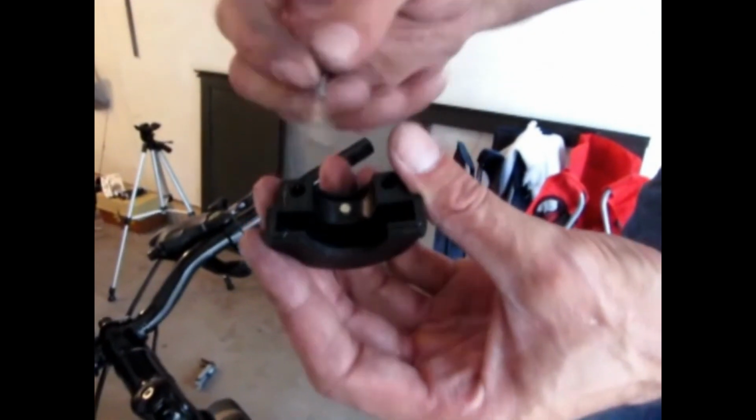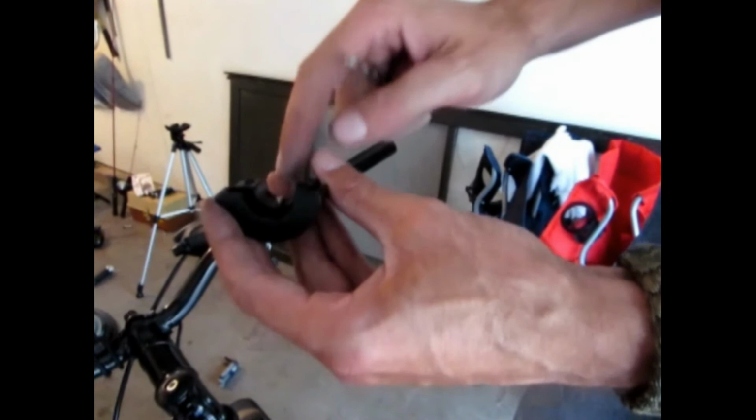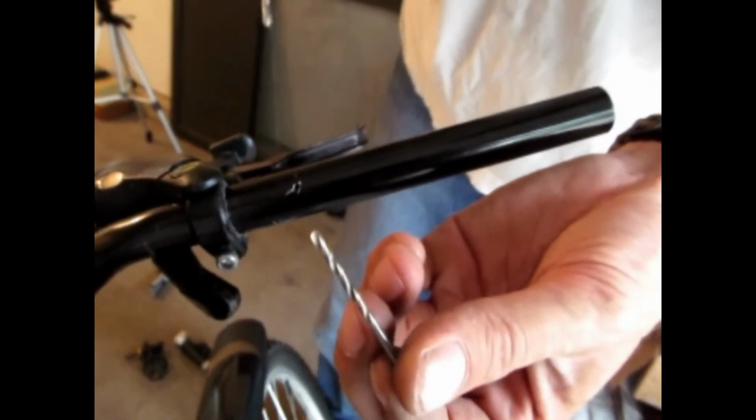With this dot, you'll want to get a drill bit that's a little bit bigger than that. So let's drill this out. When we first try to use this big drill bit, it's going to slide. Hence the scuffs. My recommendation, use a smaller drill bit for a pilot hole, then drill the bigger one.